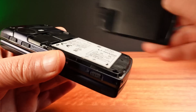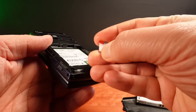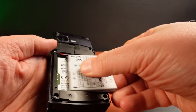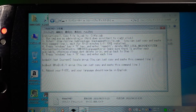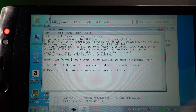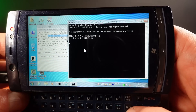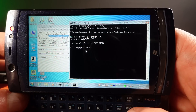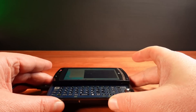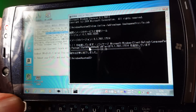I found some very helpful instructions on the Snow Akami blog for switching this Windows install to English. I've got the file I need on an SD card, so I'll pop that into the phone and get going. I'm going to have to copy LP.cab into the C directory — I think LP stands for language pack — and follow all these commands. This step is going to take 10 to 20 minutes, so I'll leave that and come back. OK, it's been going a while — that looks OK.